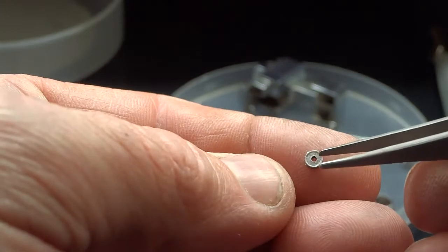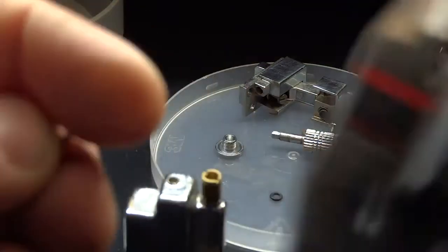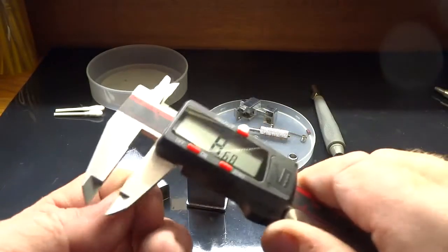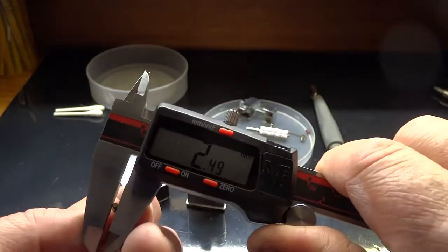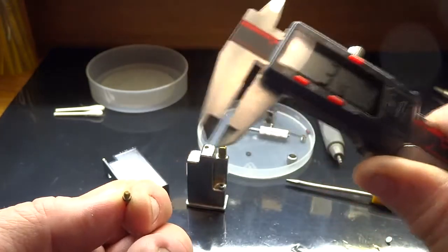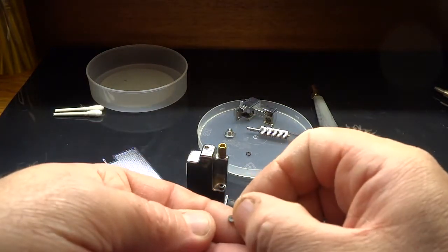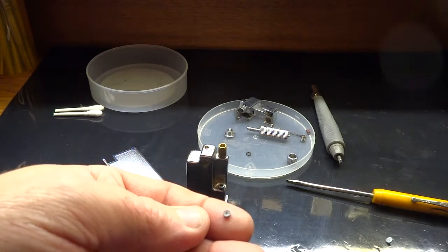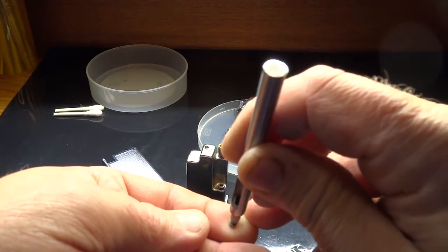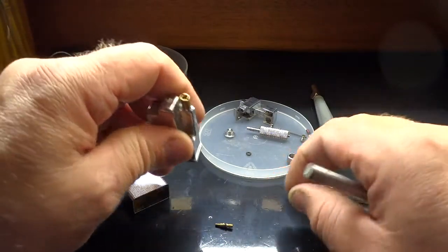Then you'll have to have the proper size punch, which, let me zoom back out, for this hole looks like about 2 millimeter. So get you another one of them 2 millimeter hole punches. Then you'll put this on a big thick paper book or something, center this as best possible, and hit it with a hammer and get it down to 2 millimeter. That'll go inside this hole here before you put the valve assembly back in.